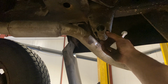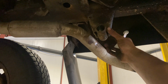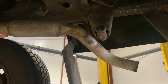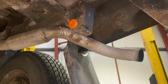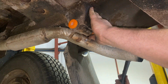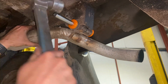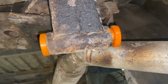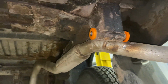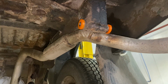So you might find if it does, all we'll do is I'll just run you through it after, we just put the shackle in and just pull it together with a bolt just to sort that out. Just see there, just as I'm knocking the tube in, it's just started to push that side out. But all you need to do, when you put your shackle clamps on, just bolt that up, it just pulls it in.